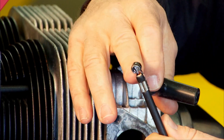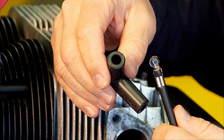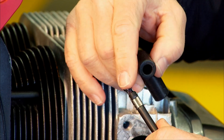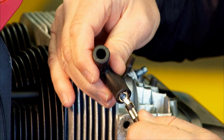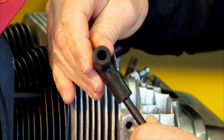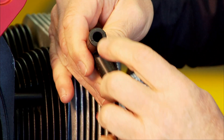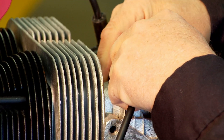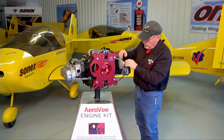The smaller hole goes on the wire, the larger hole goes on the spark plug. So you just check your alignment of your spark plug and see where the spark plug plugs in, then slide the boot on so that the larger hole aligns with that clip that clips onto the spark plug. And that's all there is to it — do that on all your primary ignition leads and you'll be all set.